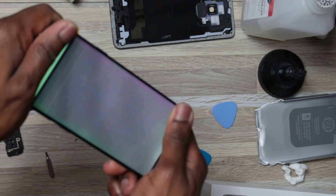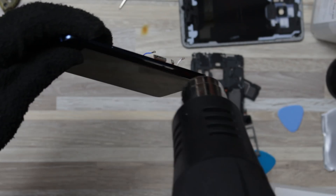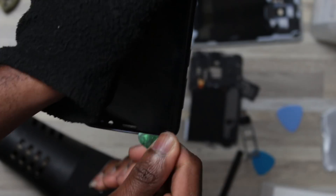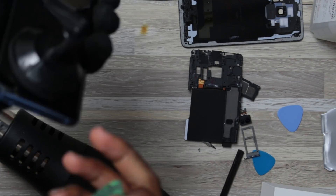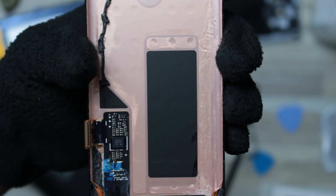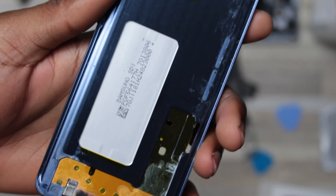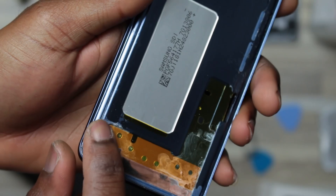The phone is not responding and the LCD is toast. At this point I knew it was the end. Let's get into the LCD and see what damage the seawater has done. As you can see, there are water marks and salt everywhere — you can see where the water sat and ate the LCD. There is salt and even burning signs, maybe due to the heat gun or probably the salt.